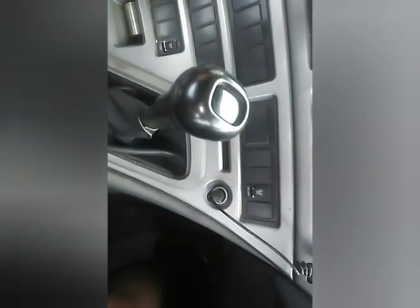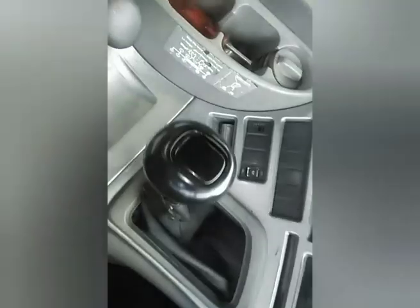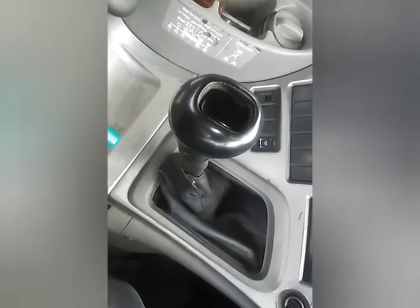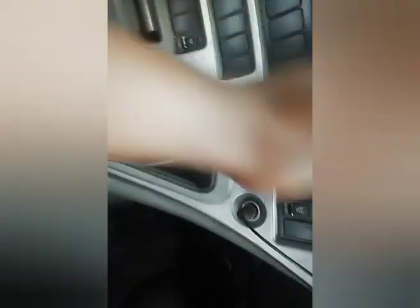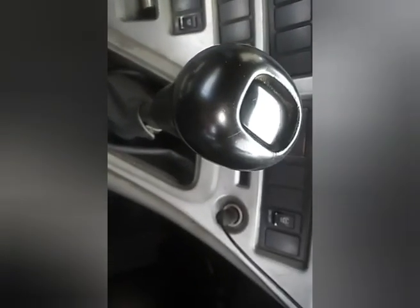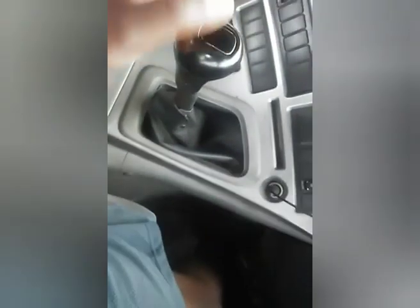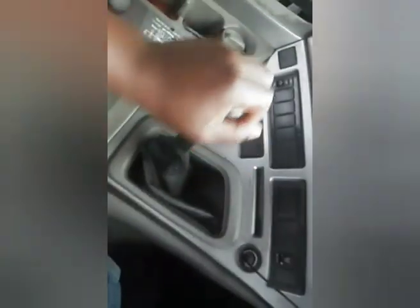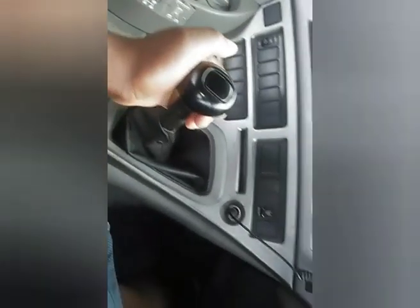From four low, back to high, straight to three low. Press down the clutch — your three low will be in. Back to high, go to gear number two high this time. Press the button, press your clutch — gear number two will be in. Back to high, then one high — press the button, press the clutch — gear number one will be in. When you want to reverse, just push it back like this and pull it back — your reverse will be in and you will hear the sound of the alarm.